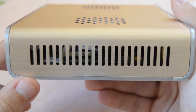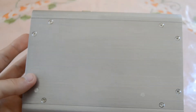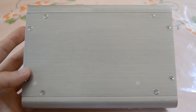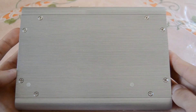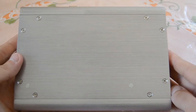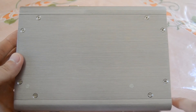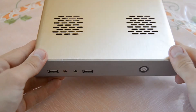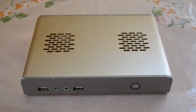On the bottom side you can see the same color as the front and back. If you want to open up the system you have to remove eight screws — four on the right and four on the left — and then you can upgrade things like the system memory, the SSD, or Wi-Fi. However, you can't upgrade the CPU or GPU because those are soldered to the mainboard.